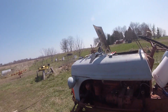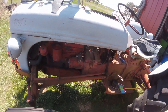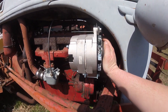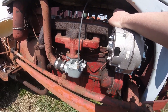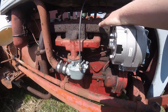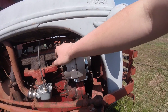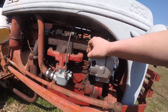We got a little section of wiring harness in, though nothing hooked up at the far end yet — just hooked up down here. We've got basically all the alternator and belt stuff in and tightened down. Now we need to go get the torque wrench because we have three head nuts that are still loose — we had to put the bracket in and move a pipe that was in the way, so we need to torque those down and then run all the wiring to the coil, alternator, and everything.